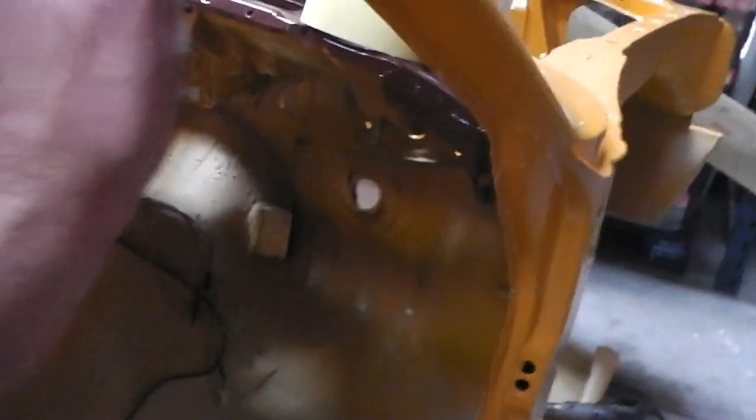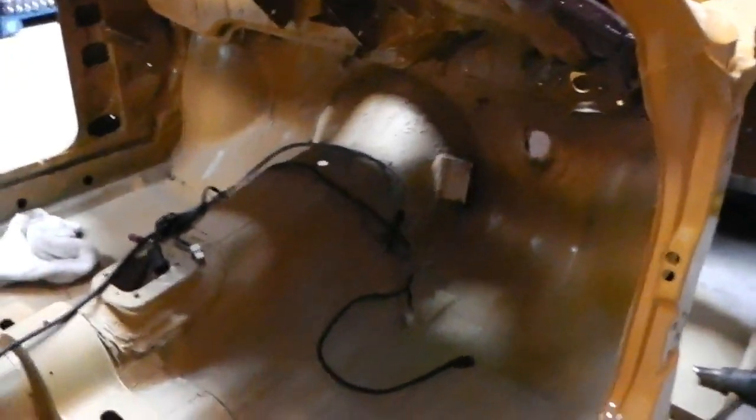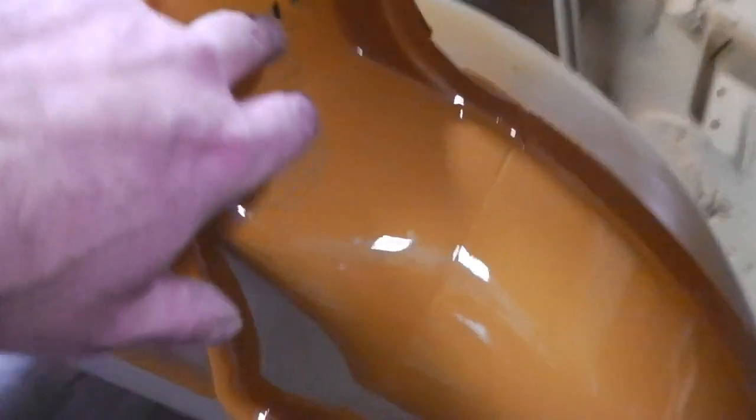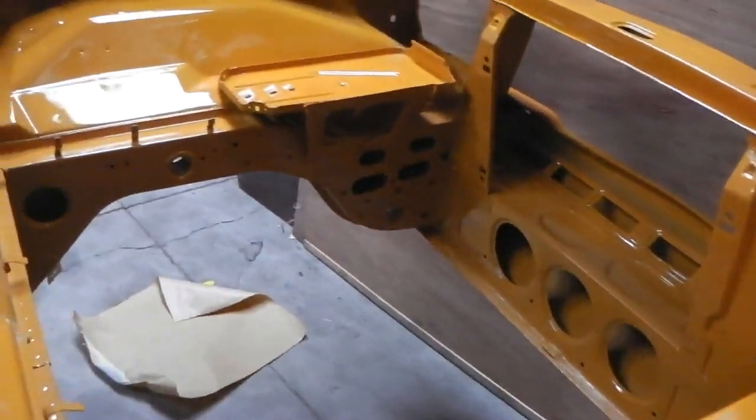What to go on first, but I'm going to put on first all the heater ducting in that bulkhead area and the pedal box and everything to do with getting behind the dash mechanically, so we'll start with that. But first I'll do the christening of the car with the rubber bung. That's a little bouncy bung that stops the flap from crashing out. We'll do that and then we'll start just grabbing bits and putting them on. We can put striker plates on, we can do all sorts of things. So bit by bit I'll keep cutting to the video as we build up engine bay, interior bits.